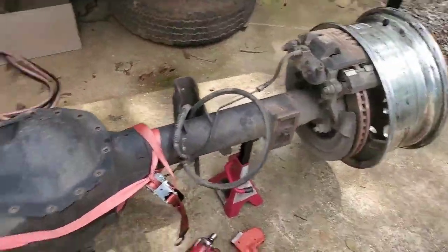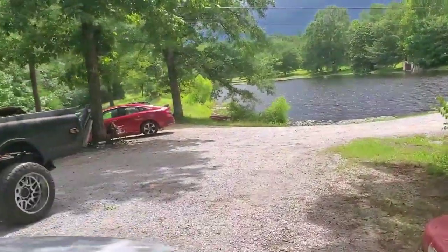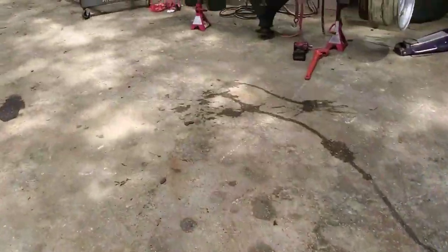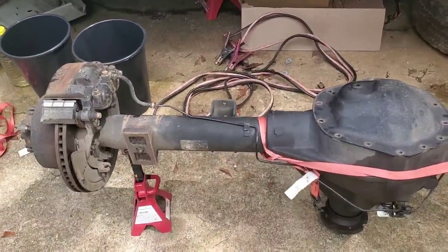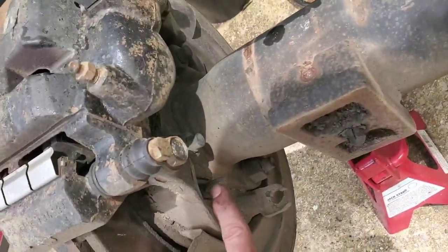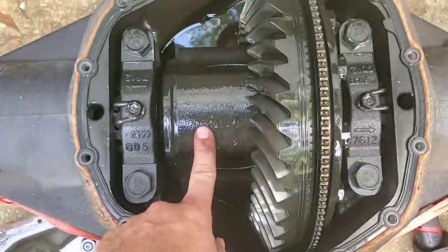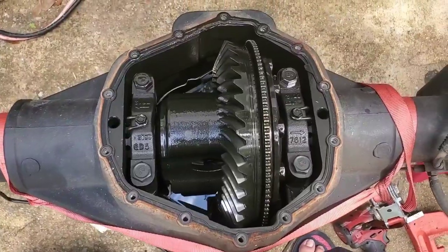We got ourselves a rear end. The truck has made it back. The El Camino is all the way over there. The biggest thing is we got ourselves an axle — this is the biggest, baddest axle that you can buy for one of these things. The axle tubes are now 4-inch instead of 3.5-inch; they do taper down to a 3.5-inch. It does have a 4.10 gear in it, but it also has the Dodge gear-driven limited slip, so I think I'm going to leave the 4.10s in it for now. It's already set up and ready to go.